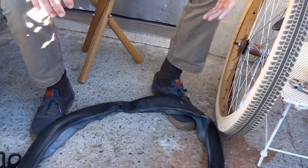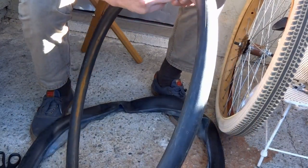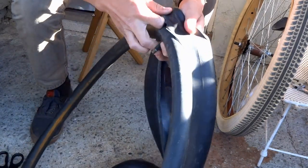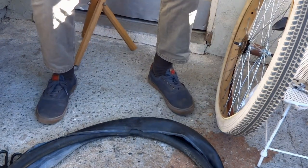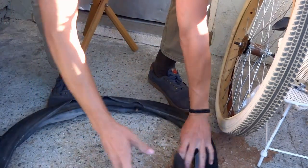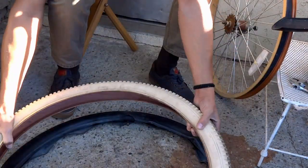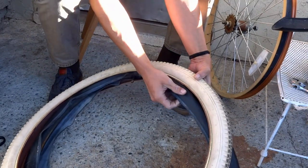So now we've split our tube. What I do with the replacement tube is I like to keep it a little bit aired up for this next step — remove some air but still keep a little bit inside. Then we're going to take where our new valve stem is and wrap it. We just lay it down on the ground so that we make sure we get it wrapped nice and evenly. So we've got it wrapped up. I usually like to take the tire off and set the tube inside of the tire just like this, making sure it still stays wrapped around the old tube.